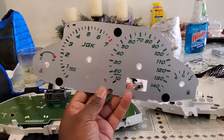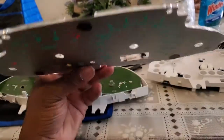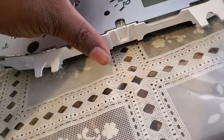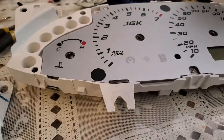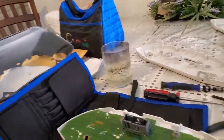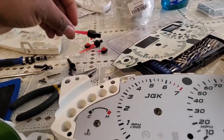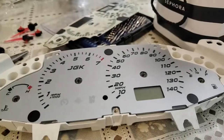Here's what the new face looks like on the old plastic piece. It's now just a reversal of everything you did to put it all back together. One important calibration note: don't put the plastic piece back on until you've driven the car and calibrated everything. When you put your gauge needles back on, it won't automatically give the right position — you'll need to manually adjust them while driving.